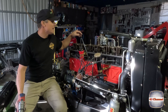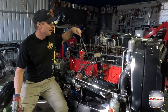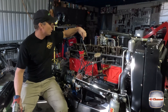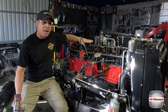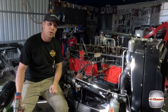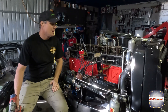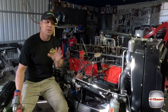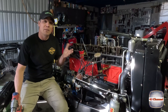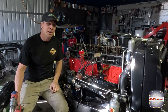The first thing you're hopefully going to feel is that oil pump running, and then you're going to feel it get a little bit of resistance, which means the oil pump is actually working. Next thing we're going to look for is oil into our oil filter bowl. What we really hope to see - which could be a bit of a rarity - is oil coming out of all the little oil holes along the top here into our rockers. To make that happen, everything has to be lined up. All the little oil holes in the camshaft have to line up with the block, which line up with your lines that pump it up to the top. Some people run the oil pump, and if they get nothing, they crank the motor a little bit, run the oil pump, and just keep doing it until they find the right position.